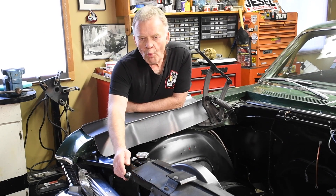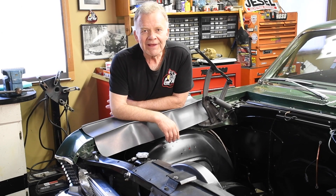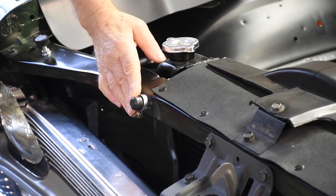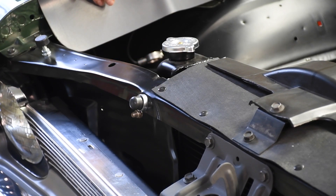Instead, the way we wire in one or even two or three different permanent switches — this way they don't have to mess with alligator clips on a hot engine. For my purposes I like to have the switch in a spot where I can access it from either side of the car. In this example I simply used an existing hole on the rad support. It's in a convenient location for me to reach on either side of the engine.